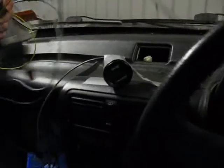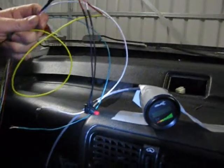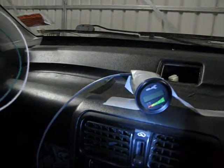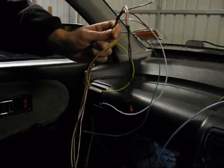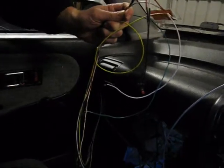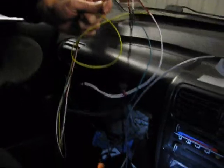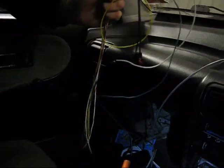There are our gauge casings. It's a button to push to change the menus. Forward and back on some of these wires — the yellow wire is reverse, which actually goes forward, and the white wire is forward, which goes reverse. The green wire is an unused throttle disconnect or something, which doesn't seem to make any difference — haven't worked that out yet. But it goes.